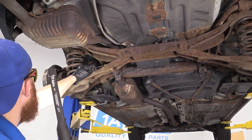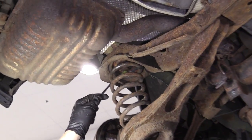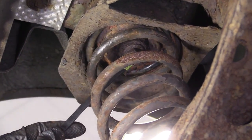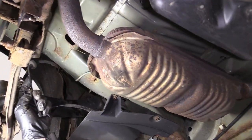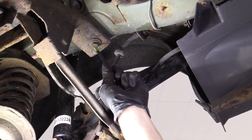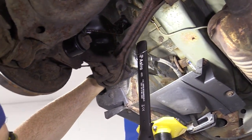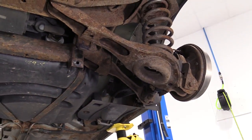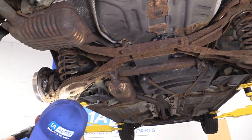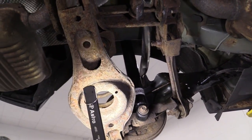It's going to be time to take down the subframe here. We're going to want to pay attention to the mounting bolts. You've got a mounting bolt that comes up inside the coil spring area here, and there's one on the other side of the vehicle in the same exact spot. There is a forward bolt right up in here, and another one on the other side. And then deep down in here, there are two bolts that hold this arm in, same on the other side. That would be all the mounting bolts for this particular subframe. You also have your shock bolt.